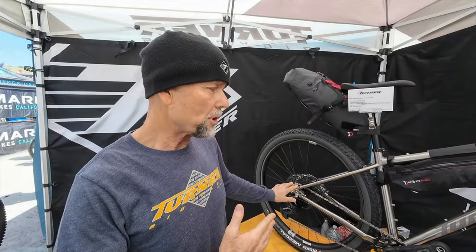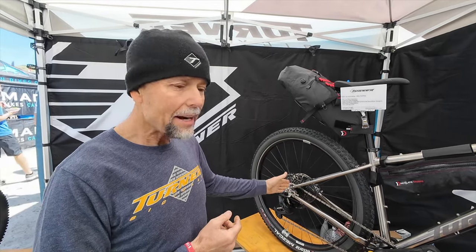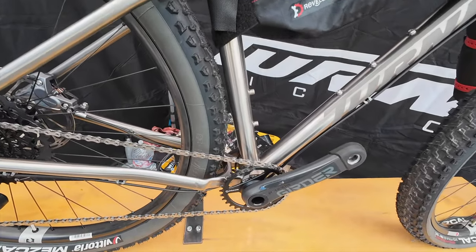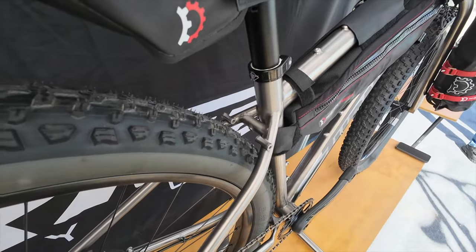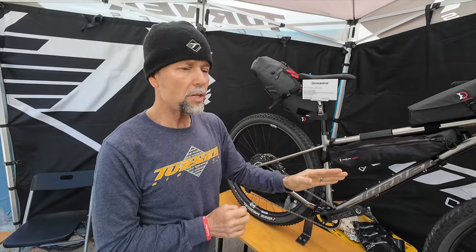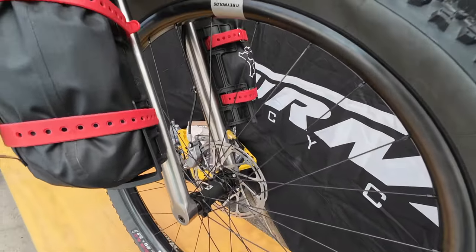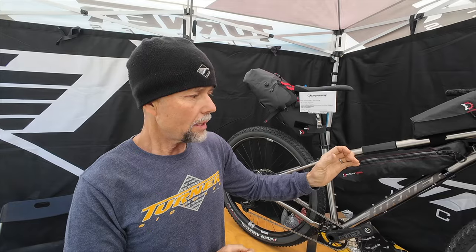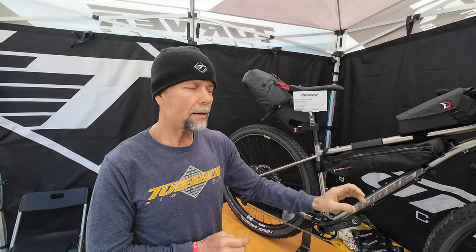The thing that sets it apart from so many others is it's got a full 25 millimeters of fore and aft adjustment. So that allows a big range of tires. The 3D printed lower yoke on this bike is wide enough for a 29x3 on a 40 millimeter rim. The bike is drawn for a 120 fork. Obviously you can put a little longer fork on there, but I am testing a fully rigid titanium fork that's 29x3 compatible, dynamo hub, cable routing, 55 millimeter offset.